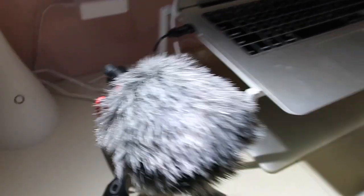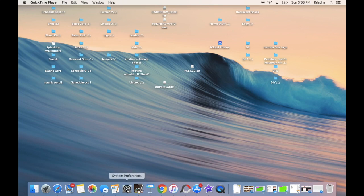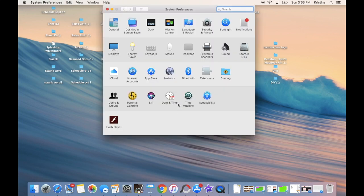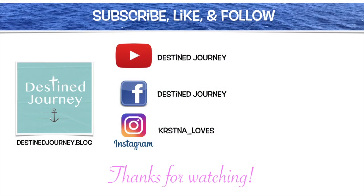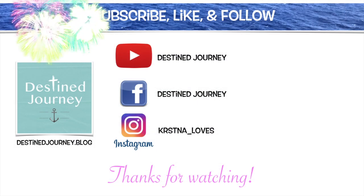As I mentioned, I am recording now with the microphone so you're able to tell the difference. Once you're all plugged in, you'll just go into your system preferences and choose Sound. Then you'll want to be sure that you're on the input screen and you should see your microphone or the adapter right here — just click on it. That's it, simple as that. I hope this solved your issue and thanks so much for stopping by.